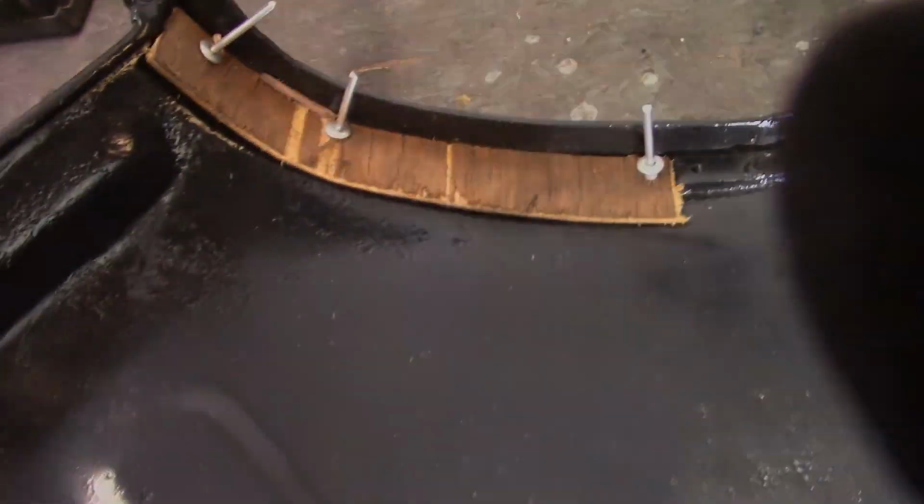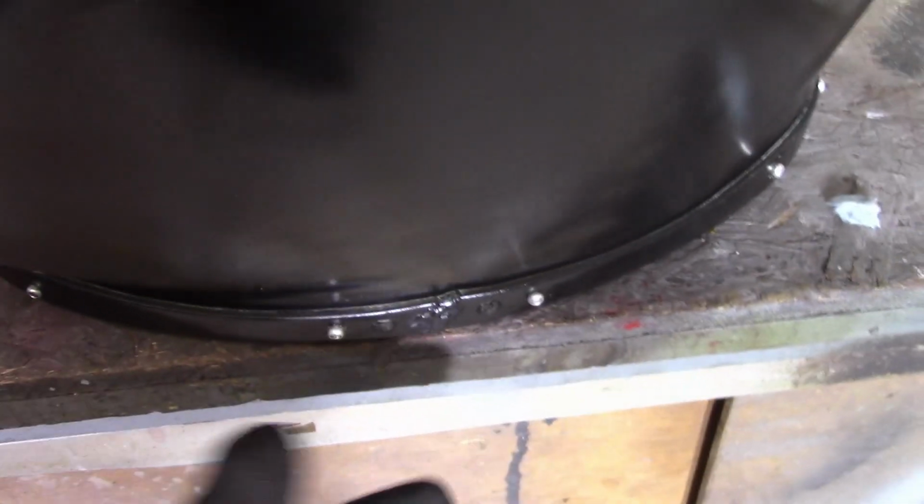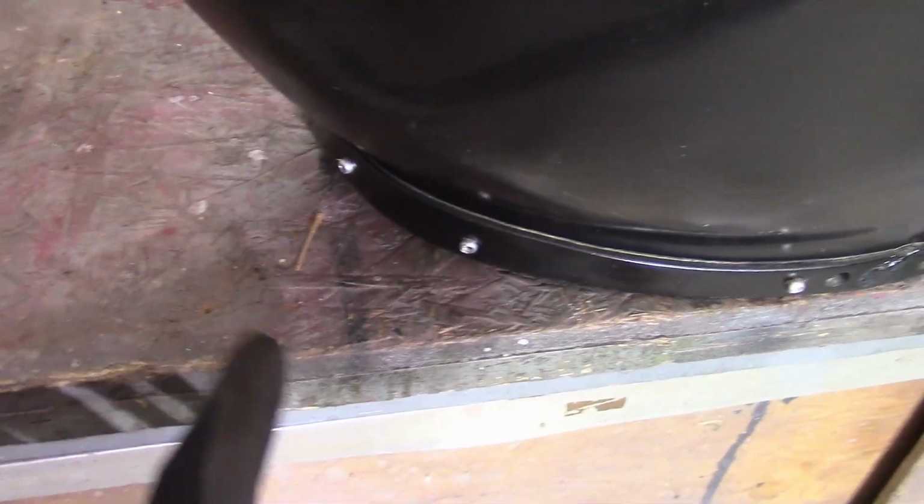Again, these are the tack strips. The instructions do say that you don't want these rivets sticking out too far. If you remember, the ones originally from the factory were just flush. Based on where they're sticking out, however, I don't intend to grind any of this off, because if you grind too far, then you pop out the center point that got compressed and mushroomed, and then the rivet is worthless.